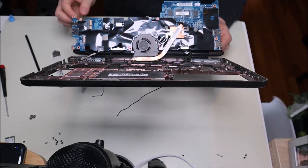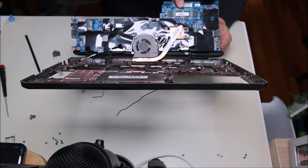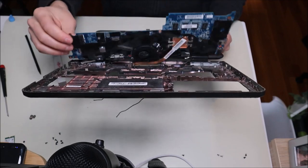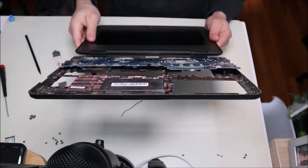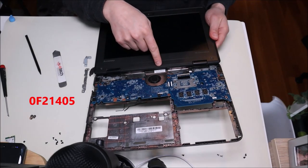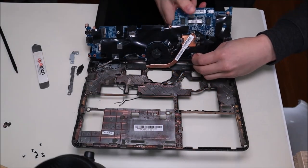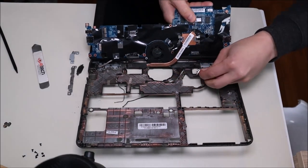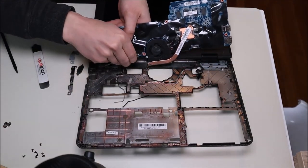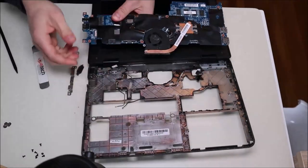For those of you looking for a part number for this motherboard — right here there's a number in standard Lenovo format: 00HW154. There's also a part number on the flip side: 0F21405. To free the motherboard completely, pull on the port — that comes right up. Same with the LCD cable, just pull. The power button port unplugs by pulling out.